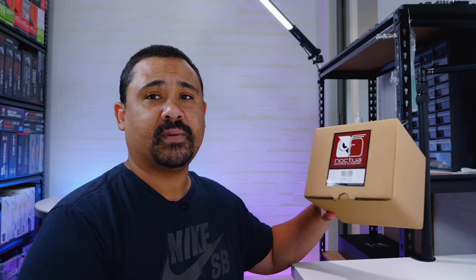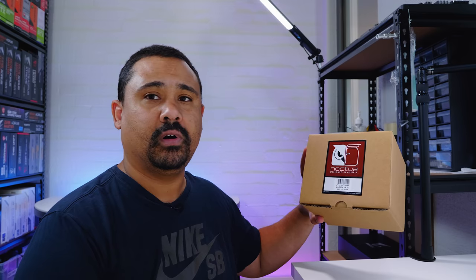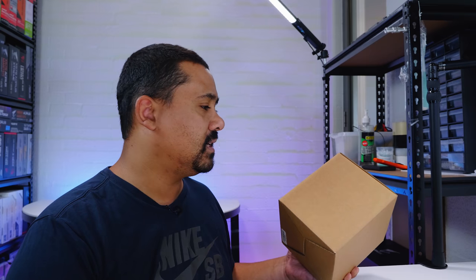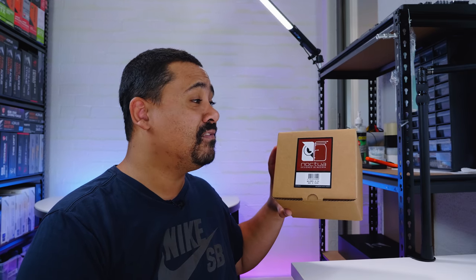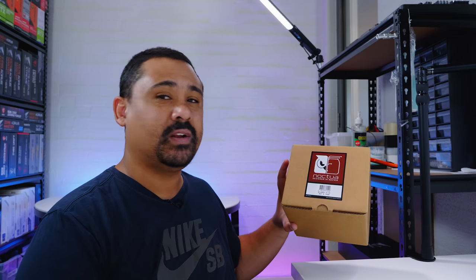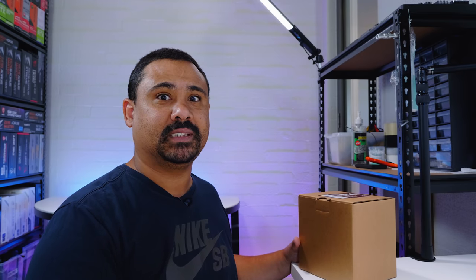One of our other servers that we've decommissioned at the moment is using this. It's the NHD9DX i4 3U. It's a 3U server cooler, 2011 sockets with ILM or with the regular square mounting, or some older stuff like 1356 socket. The Noctua AM4 adapter kit actually works for this cooler. So I went and ordered one from another computer store, U-Mart in West Ryde, which is really close to us.